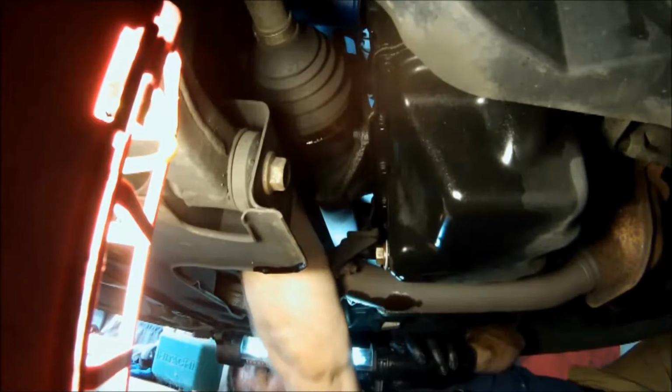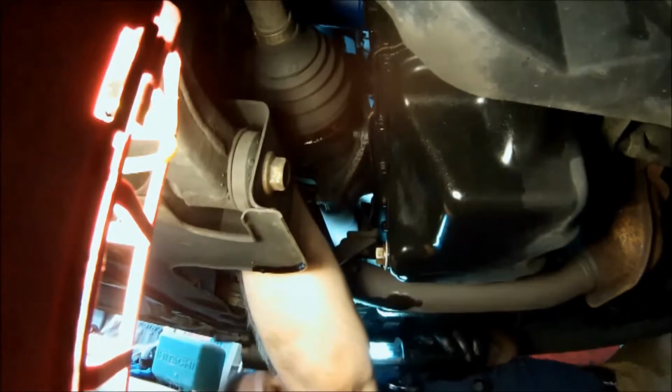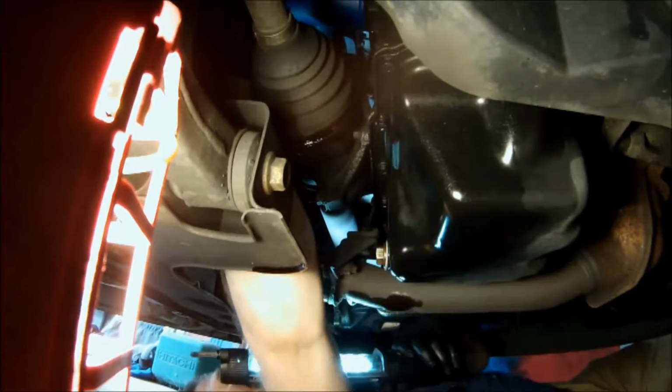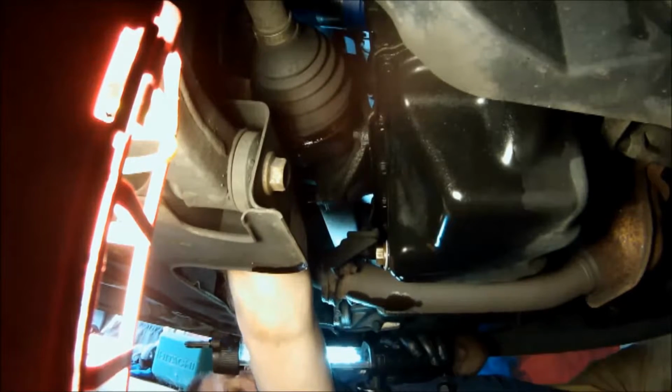We're just spinning that onto the side of the engine. And the general rule is, you spin it down till it meets the mating surface and then 3/4 of a turn. So we're just going to turn this 3/4 of a turn here. Make sure it's tightened up by hand. That's all you need to do. Should not leak. Okay.